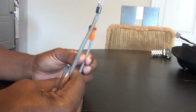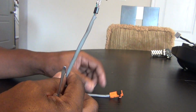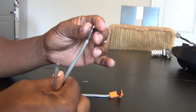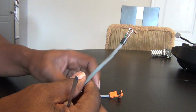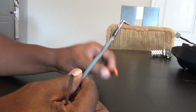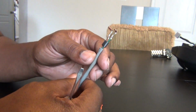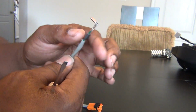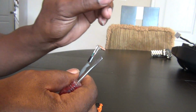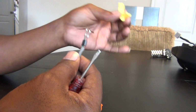They're going to be hanging on your car out of your steering wheel like this pretty much once you get both sides off. And once you do that, you're going to do what I just did with this one. You're just going to basically take it apart and it'll look like that. You'll do the same with this. And then once you take them apart, and as long as your airbag connectors, again, they look like this and they're in that L shape like that, you're going to be fine, okay? And then once you take your plastic connector part that's good that you got from the junkyard, once you take those out, you're just going to do everything you just did in reverse.